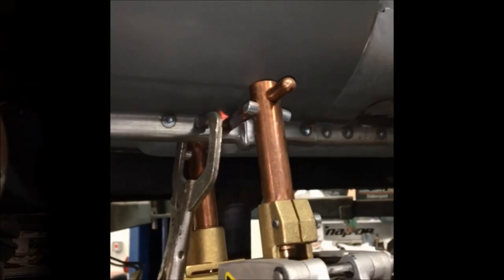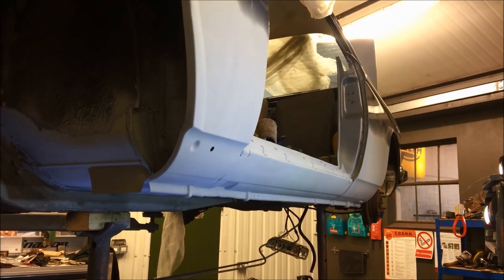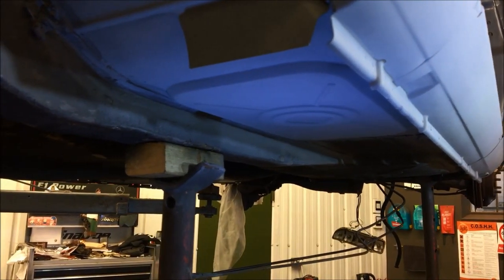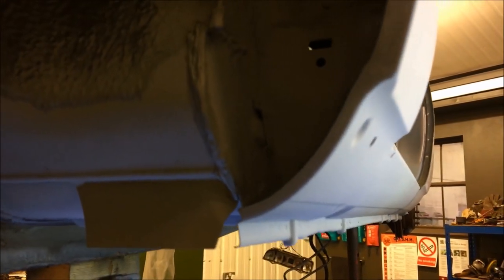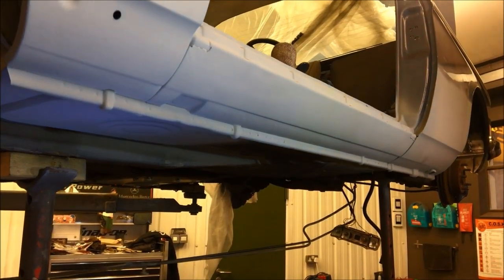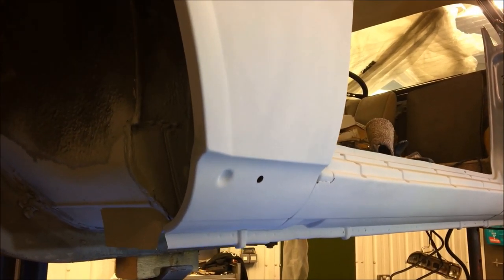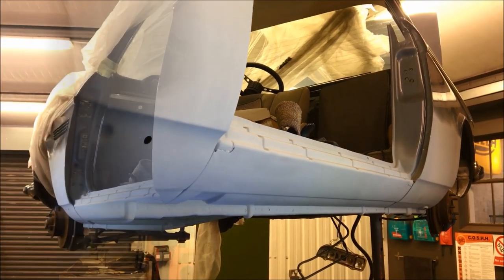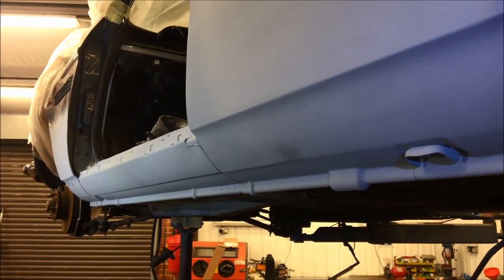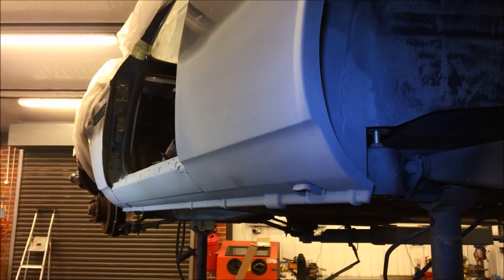The fabrication is now finished to the nearside of this 3-litre CSI and it's in primer, ready for paintwork. That's the nearside front floor pan repaired, bulkhead sections repaired, the lower section of the A-pillar, inner sills, inner sill membrane, outer sill, and those lower wing sections repaired front and rear. Work shall now begin on the offside sill.